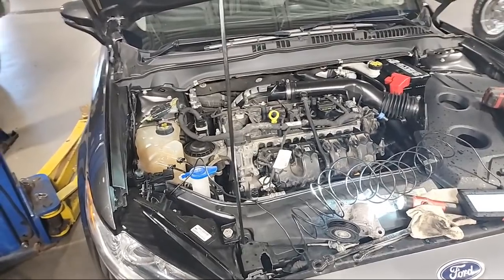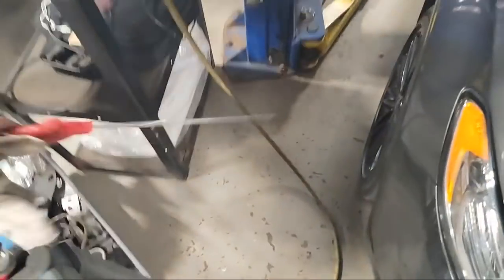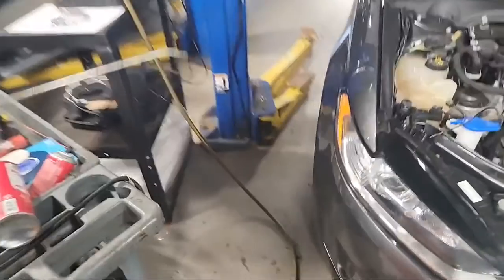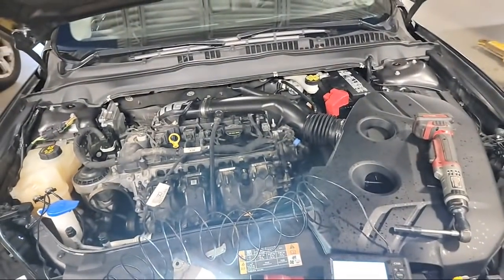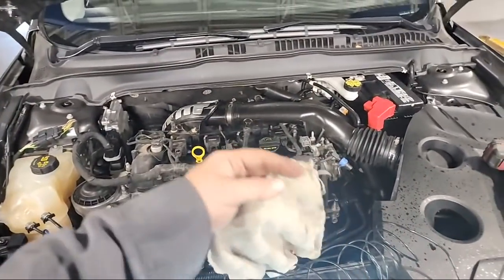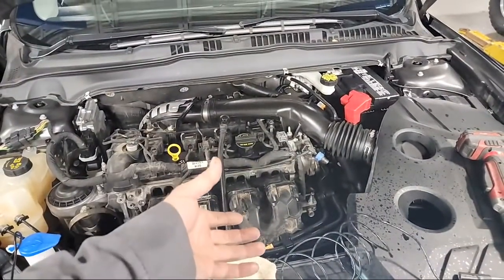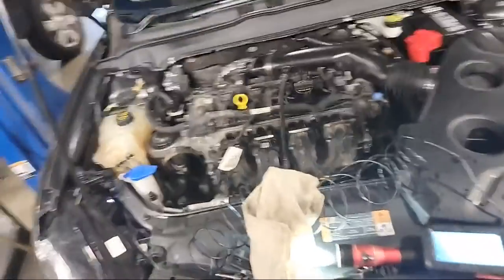That's the gist of cleaning these — get down in there, fill it up with as much chemical as you need, clean those valves with a pick, just be nice and easy so you don't gouge the cylinder head. When you're ready to blow everything out, use a long air gun like this. Put your rag around that cylinder and blow the stuff back out into the rag. Make sure nothing gets back into the intake manifold — lay rags over the intake manifold ahead of time, keep your rag over that port so nothing goes back down in there.